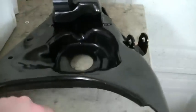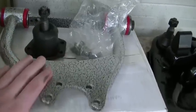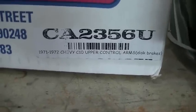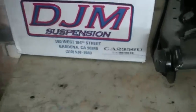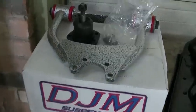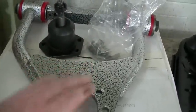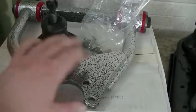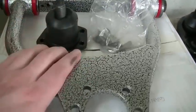Here's the other one — this would be the passenger side. And then I've got new tubular upper control arms from DJM, part number CA-2356U. It says on the packaging 71-72 C10 with disc brakes, but I contacted DJM and they assured me these also work for the 73-87s. These are longer upper control arms to adjust for negative caster, which often happens when you lower a truck. They're brand new with new ball joints, hardware, and polyurethane bushings — everything's set up.